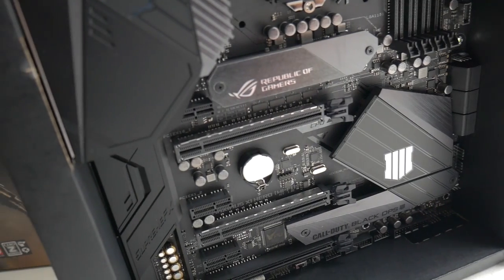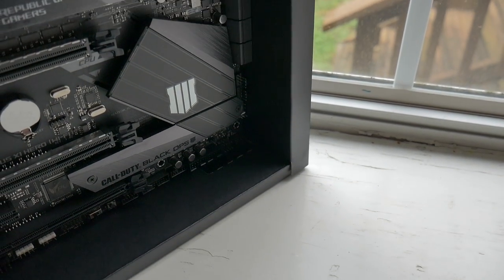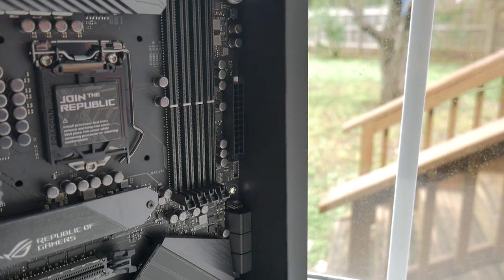Keep in mind that as soon as you go to two-way SLI, you drop those rails to x8 instead of x16. They are reinforced rails and look pretty slick. As far as memory goes, it isn't a crazy overclocking motherboard, so it does still have four DIMMs as opposed to just two DIMMs on some higher-end ASUS boards — those two-DIMM configs are primarily for LN2. This board is more balanced and geared toward mainstream use.